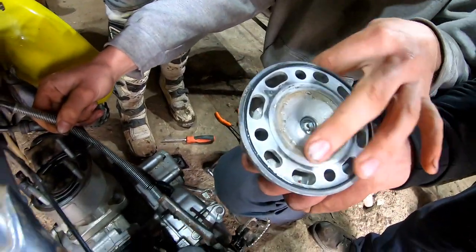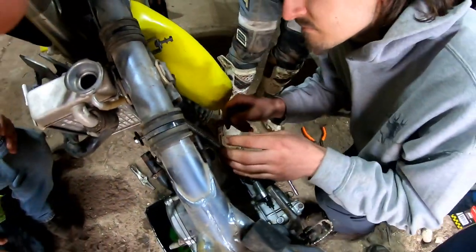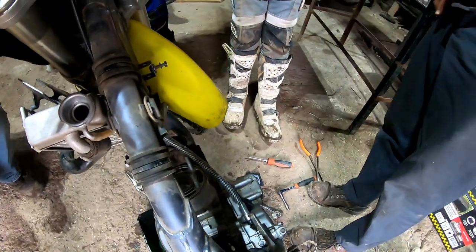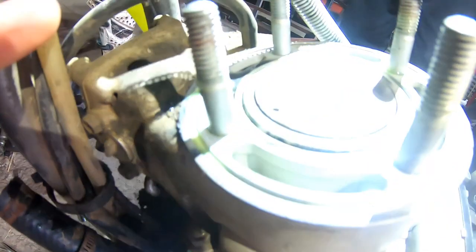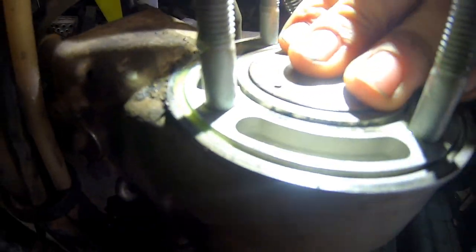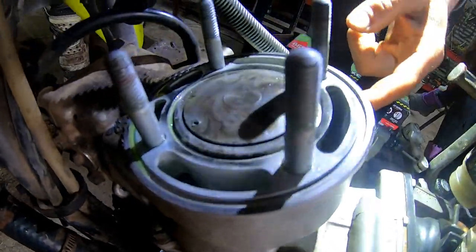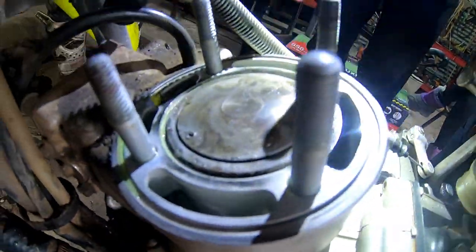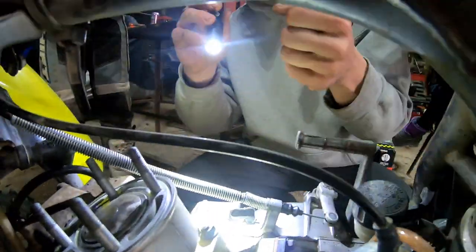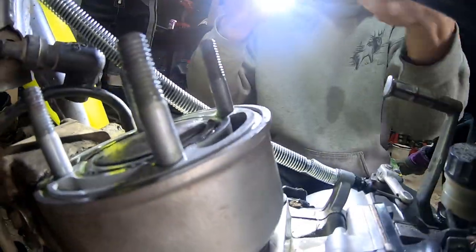You can see it's all there — a bunch of detonation. Want to shine a flashlight? I wonder what the old spark plug would look like — it would be very aluminum metallic. You can see a huge chunk got stuck there. The piston still moves, so the rings aren't stuck. It's weird that it's stuck — unless a rod bearing let go and it came up to the top, and that's why it's stuck. What happens when the rod sticks and gets stuck on top — it just saws, it just welds itself to the crank.